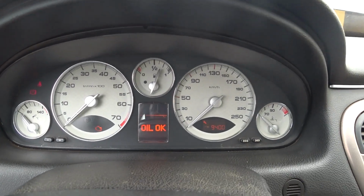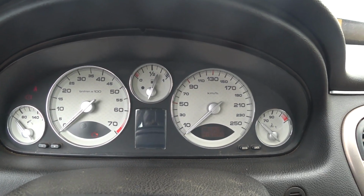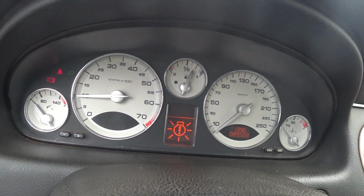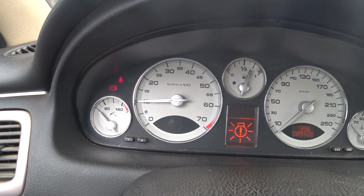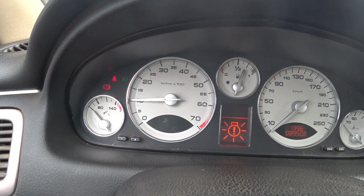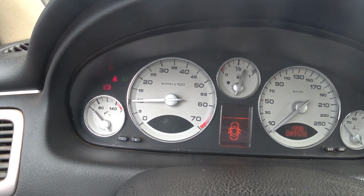Okay, all right. I'm going to wait for the combustion to drop a little, the engine speed, so that the engine will get a little bit warm before I put on the AC. Like I always say, you can see it's still at 1000 RPM. At this time, the engine is running rich. It's consuming a little bit of excess fuel, which is normal. So I'll need to wait for it to drop down a little before I can put on the AC.